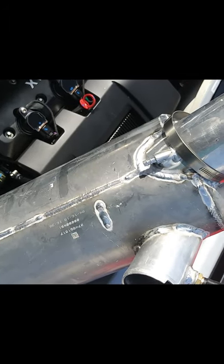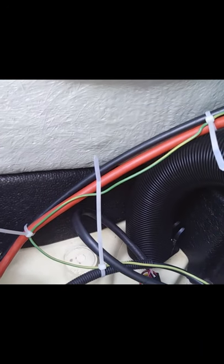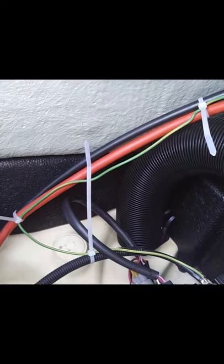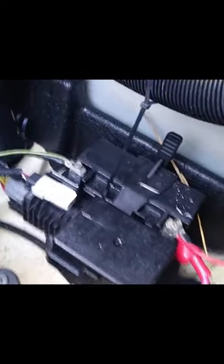Once that's out you can properly put in your bilge pump — it's an eight-hour job or more. In the Limited you can see we've taken out the exhaust water lock and put the bilge pump out there aft towards the center, allowing two or three inches in front of the drain plug behind it. The drain plug sits up about an inch, which is why you always have water in your ski. For wiring, we've taken an orange three-conductor cable back to the bilge pump — one for auto, one for manual, and one for ground. We add a fuse and another hot wire.